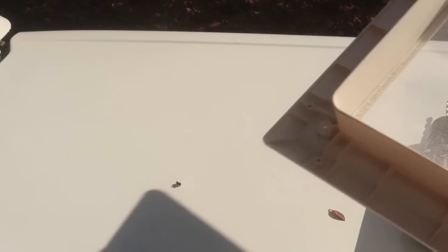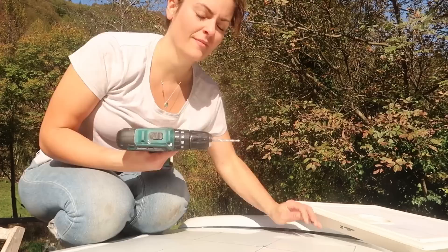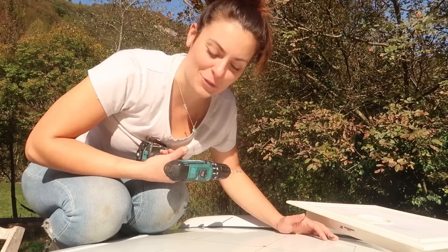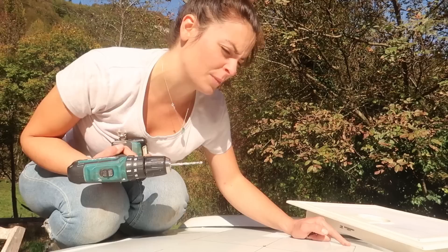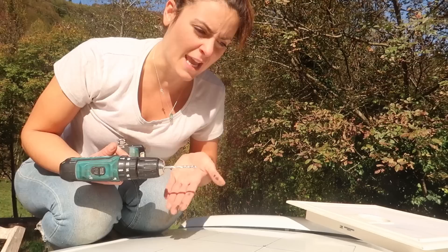There we have a little hole — let's go and check it from the top. Now I'm going to mark the perimeter of the vent and then we're going to make four holes in the four corners. Now that I've checked the measurements around twelve times and I'm satisfied they're correct, I'm ready to drill the four corners of the perimeter of the roof vent. This will allow the jigsaw tip to enter the metal, because otherwise you wouldn't have an entry point, and it also gives you nice, clean square corners.